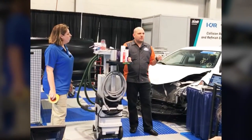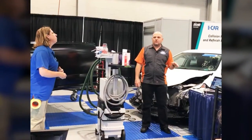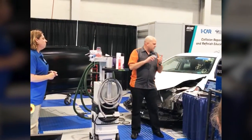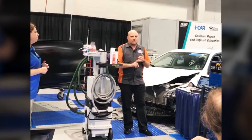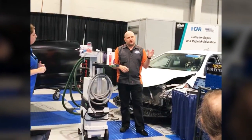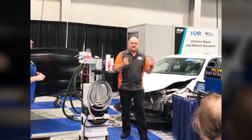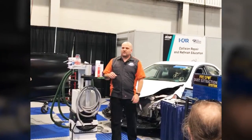We're also letting you know which systems that module is responsible for. That particular cruise control module is responsible for the adaptive cruise control, collision warning, and collision braking. So what if we take that sensor off, put the sensor back on there, and we don't aim it, or we aim it improperly, and let's say it's pointing towards the sky where it doesn't belong.